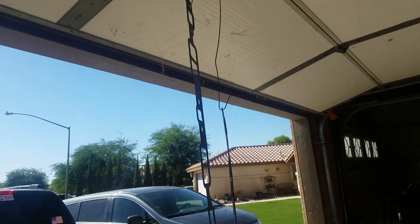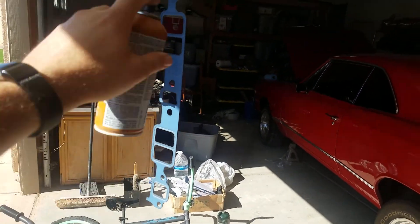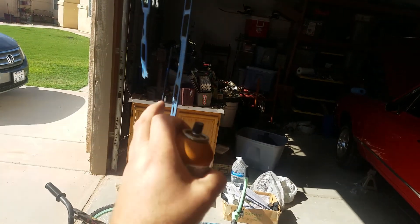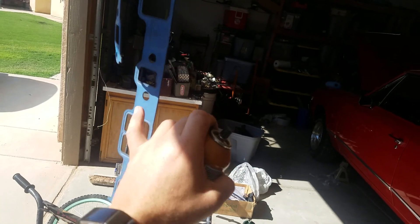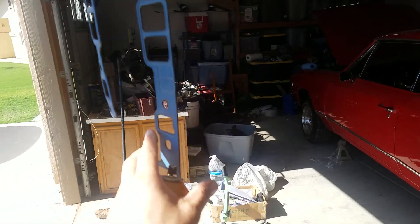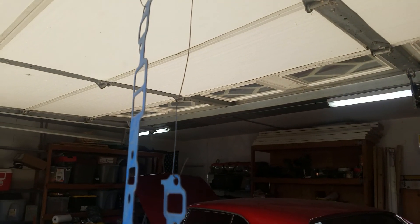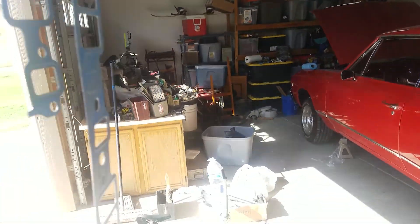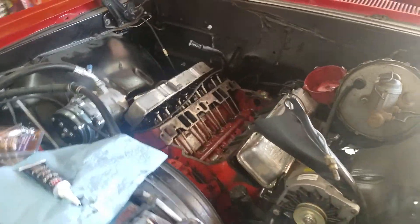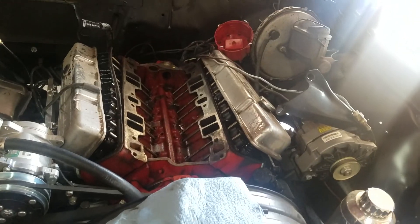For the gaskets, I rigged up this little thing with bailing wire — I have a little loop here with the gaskets. I'm going to give them a couple of coats, make sure they're evenly distributed, and then you want it to be just tacky to the touch — not running down, but not dry either. Once they're ready, the order has to go fast, which is why I'm not going to show it on video: I'm going to do the RTV first, spray these down because they dry very quickly, get those over there, slap it together and get it bolted and torqued down. The next video is going to show this magically assembled engine and explain how I got there.